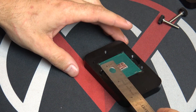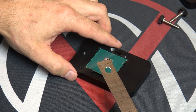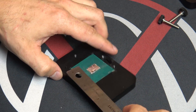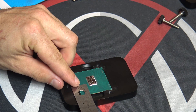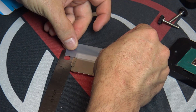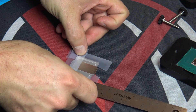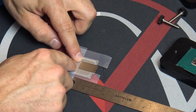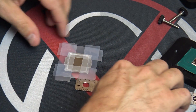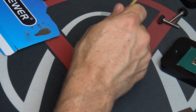This next part may be a little tricky — keep in mind that the heat spreader is smaller than the actual chip. You want to use the ruler to measure the position of the die on the PCB, and then mask off that area on the underside of the heat spreader, because you only need to apply the thermal interface to that particular location.